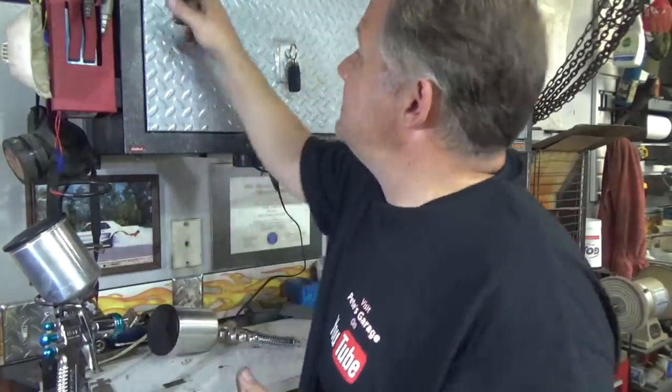They'll even tell you what size tip to use, fluid tip, 1.2, 1.3, 1.6, whatever it is. They're going to recommend that. They're going to recommend how much PSI. Not only that, when they give you the paint, they're going to give you, I got some right here.